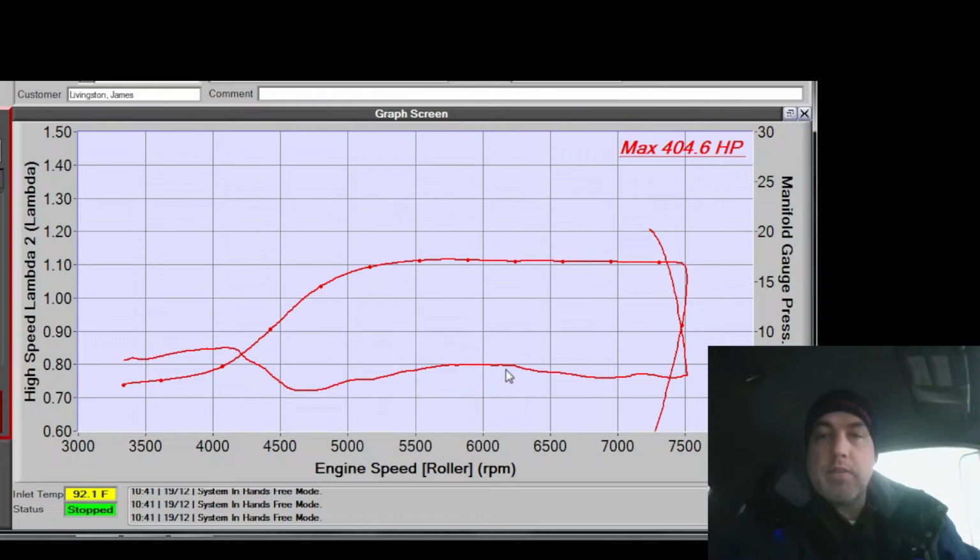So let's go do that. I said 3% at 6,000, is that what I said? Yes. Fortunately, this fuel map isn't done at 6,000. It doesn't have a spot. So we're going to multiply 1.03, boink, like that. And then I'm going to add a little touch one right there. Blink, blink. Two little blinks. Blink, blink. There we go. It's like a Mario game. And then I'm going to go right here. Blink, blink. And then I need to lower it at 45. So 47 actually. 47 actually just got an up arrow on accident. Let's do this. 1, 2, 3. That's not percent, that's half percent. So that's a percent and a half.